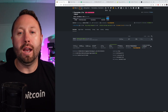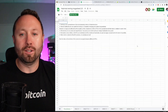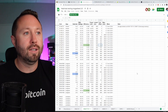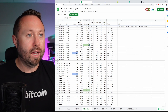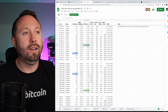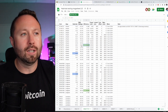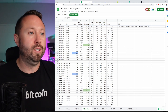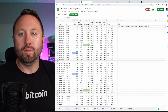Because this is running on ETH hash, we can use our older Ethereum overclock settings. Seb Heslow has an amazing series on all the different 30-series cards, algos, and hash rates, with spreadsheets showing fantastic efficiency numbers. For our 3060 Ti, his green (most efficient) setting targets about 60.3 megahash at 136 watts at the wall, with efficiency measured by hash rate divided by watts. We could go slightly higher to 62.4 megahash (the blue entry) but that puts us at 152 watts. We're going to go with: negative 502 core offset, 2600 memory, and 120 power limit.